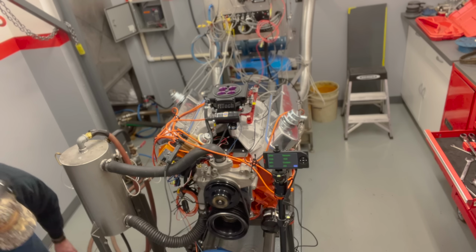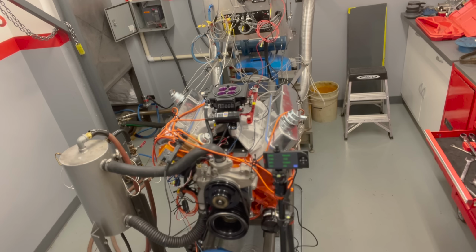I just don't know if it sounds right up there. It's bouncing. At 3 grand, the timing mark is not bouncing. At 4 grand, it's starting to bounce, and I think I can hear it, because it sounds like it's missing just a scoche. Well, I have a hard time holding it. So it might be 4,000, or it might be you. Maybe both. Because at 2,000, 3,000, it's easy to hold it there, but I get to 4 and I keep going up and down over it.